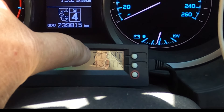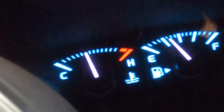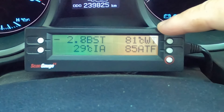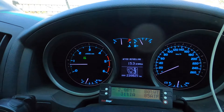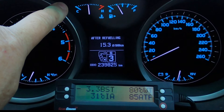I never would have picked that with the factory gauge because the factory needle does not move in a meaningful way for those differences in temperature. The only way I would have picked that was with the digital gauge. There's my water temperature at 71 degrees and there's my factory gauge — where the needle sits at 71 degrees. So right now the car is running about 10 degrees cooler than normal operating conditions. Now we're up to normal operating temperature: 81 degrees Celsius, and that needle deflection is almost identical to where it was at 71 degrees. So the factory gauge barely moves across 20 degrees of water temperature, between 70 and 90 degrees.